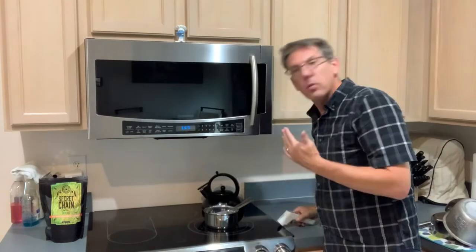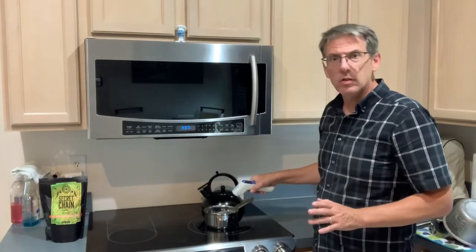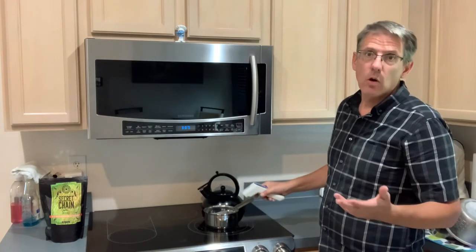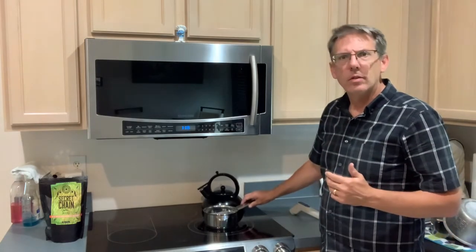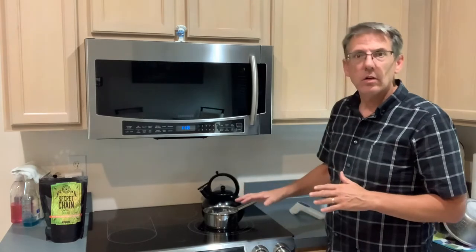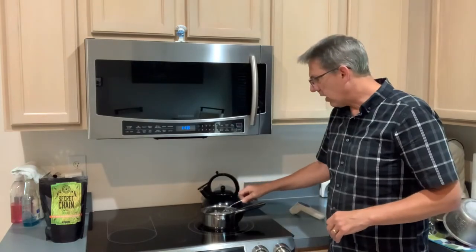I'm back — the wax is all melted. I'm going to hit it with my thermometer. I've gone a little high; I got caught up watching TV. It says 173 degrees, and I'd really like it to be close to 160, so I've turned the heat source off. I'm going to continue to monitor the temperature — I don't want it to fall back below 155 or 160 degrees. That took about eight minutes on my stovetop to melt. Now I'm going to give it another maybe 15 minutes. Every few minutes I kind of stir it around in here and make sure there are no air bubbles.